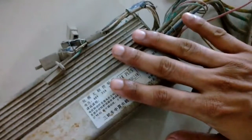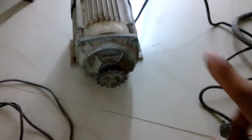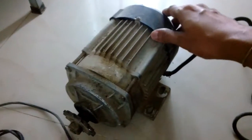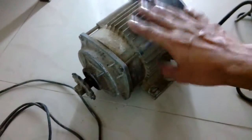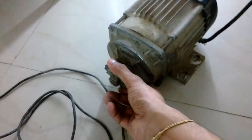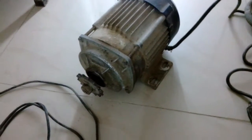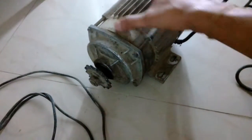The controller power should be a little bit more than the motor so it can handle the surge or load when the motor puts load on the controller. So this motor is 500 watt. I've also talked with a few people who own pedal rickshaws converted to run with this motor, and they confirmed it's 500 watt. Pedal rickshaws or cycle rickshaws don't need more than 500 watts, so 500 watt is enough.